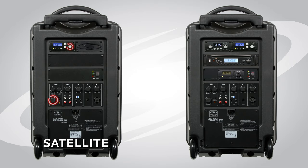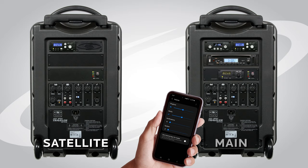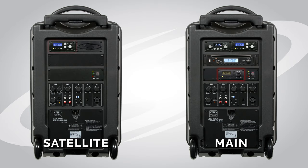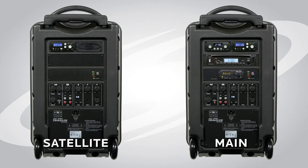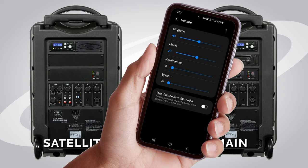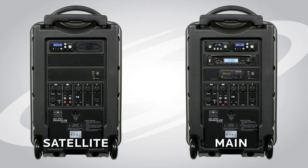Now we're going from the mobile phone to the main Traveller unit, out of its AudioLink transmitter, into the satellite wireless receiver, and then out to the speaker. You've got a couple cool things you can do here. We can control the main Traveller volume with its master control and that won't have any effect on the satellite speakers. However, if we change the volume of the Bluetooth on our mobile phone, that will adjust its volume across all connected speakers. If we adjust the volume knob on the AudioLink transmitter, that affects volume on any and all satellite speakers.